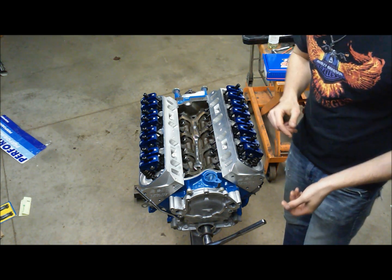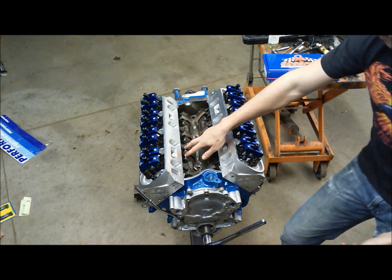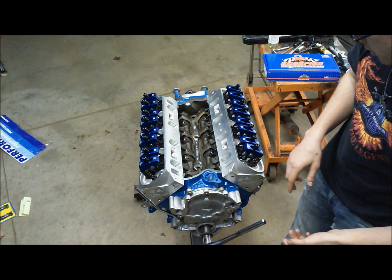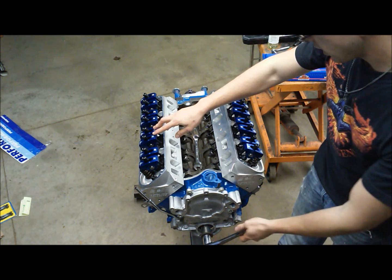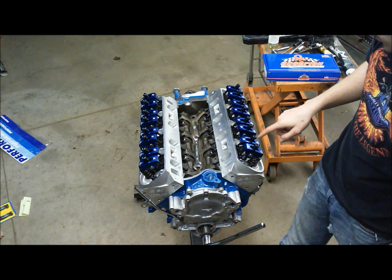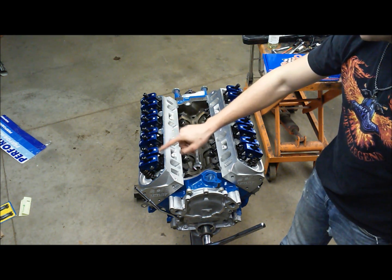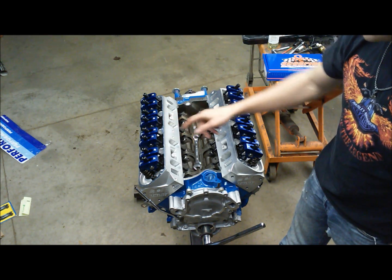And so anyway, a good one you can see from the camera here is probably this one right here. So we're dealing with cylinder 2. So we're going to go ahead and turn the engine around. Notice I have all my rocker studs on here, and they're not tight. They're 2 or 3 threads in, just so they're sitting there. And I've removed all the set screws.